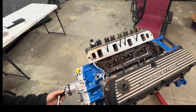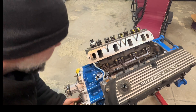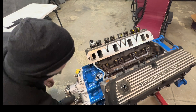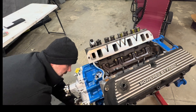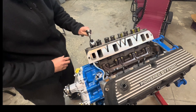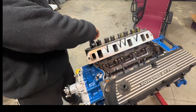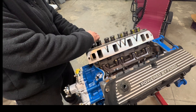Now we want to go through two full rotations with our valve working, just to make sure we get some good marks on the valve tip. There's one rotation, there's two. Then we blow it apart carefully — when you're removing the rocker, be careful not to move it too much side to side because we don't want to mess up our mark.